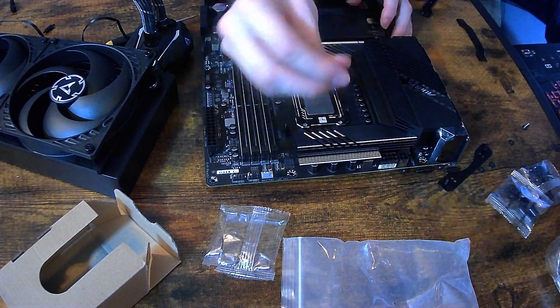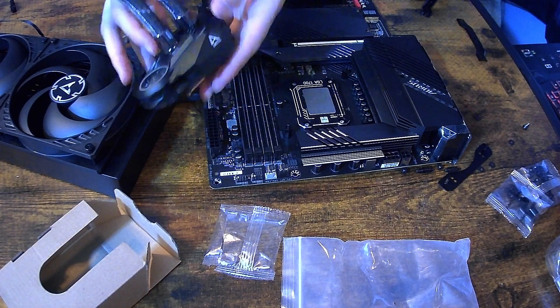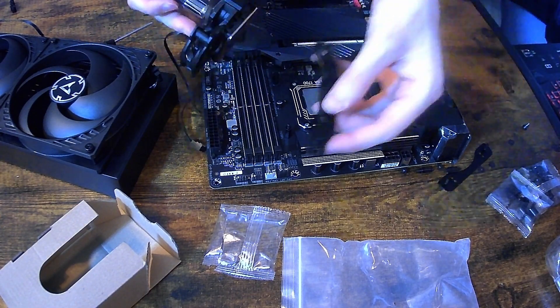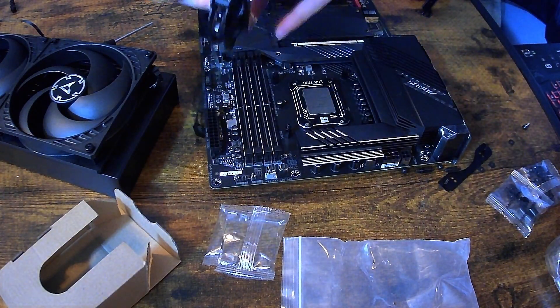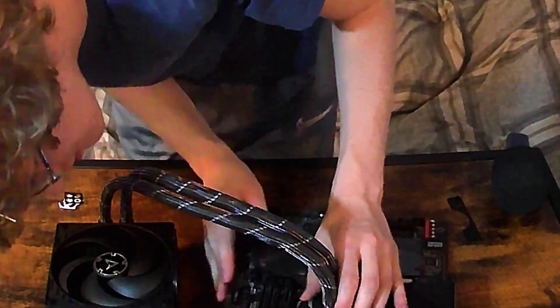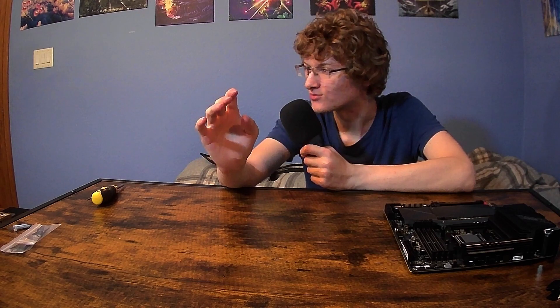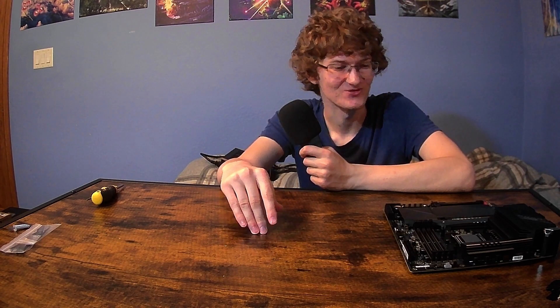I've stuck my camera to my mic stand so that you guys can see. We just placed that in the far out end of this, and I checked to make sure there's a little indent — a little bend on the back plate here — and we're actually going to be placing that not cupping the back of the 1700 socket, but instead it's going to be pushing out against it. I had that backwards at first. Always read the manual for these things if they have one. Now that that's properly seated, what we're going to be working on is getting the case and mounting the motherboard into it. The cooling system is a lot thicker than I thought it would be, and I'm going to have to figure out where to fit it.